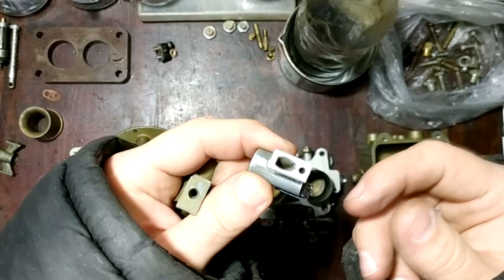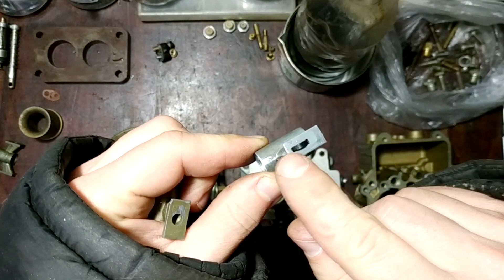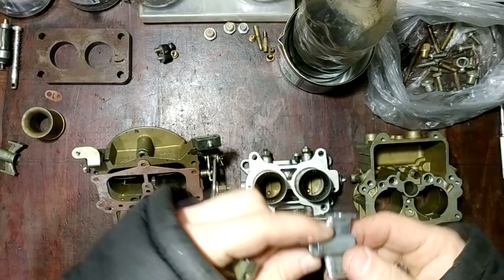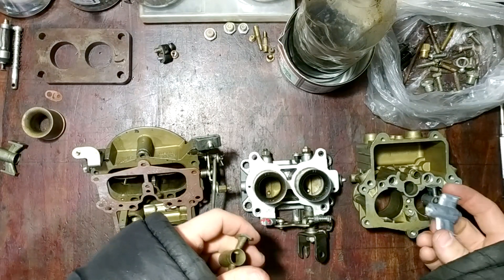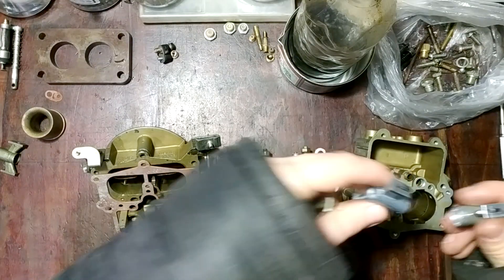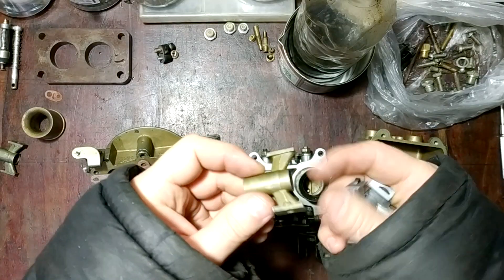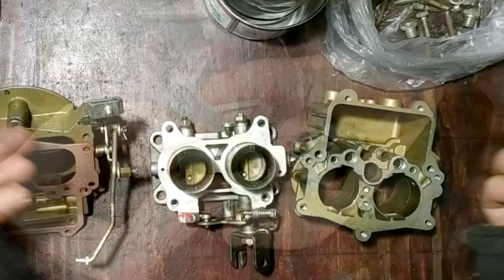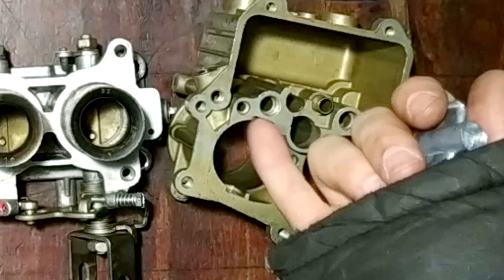I made some work with a rasp for making the wings shorter. The new auxiliary venturi can now be easily installed at the right place with no harmful force. As a nice bonus, we now have springs which help to have no leaks between the auxiliary venturi and the emulsion tube channel.